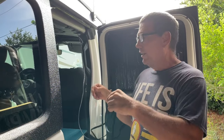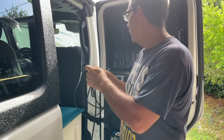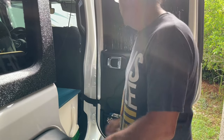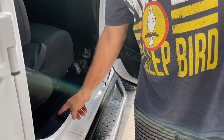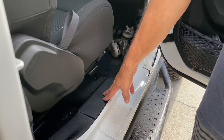This is the wire I need to run for the third brake light that's in the back, and I'm going to run it down through this B-pillar inside underneath that plastic. Then once I do that, I'm going to run it down underneath this piece here — underneath there is a large wiring harness that I need to tie into. I need to splice into a wire in there, and then that third brake light should work.